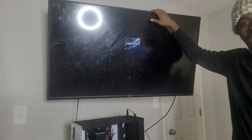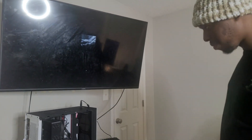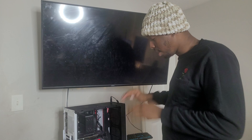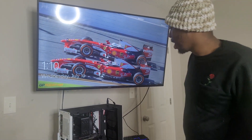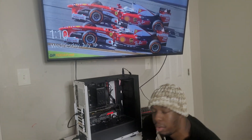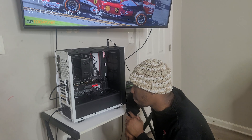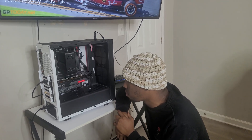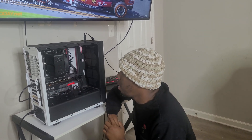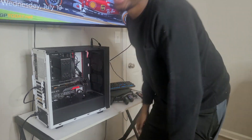Alright, so it's JFP1 — and that did it! I really thought it was JTPM1 but it's JFP1, noted. Oh wow, we got signal — that's good! We got visual! So in this case it was a loose cable. I'm not sure if he was cleaning inside of it and unplugged something by accident, but in this case that was the issue. I hope that this helps you guys in some way. Thank you guys, next video coming soon!